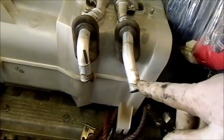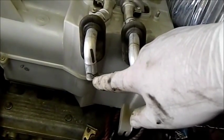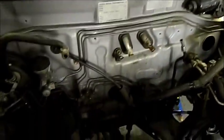So very, very worthwhile activity when you service your car to change your coolant every 40,000 Ks. That's what Toyota recommended. It's a lovely red coolant. It comes in a small bottle, a small concentrate, and you just mix it with regular water, and it really does do the world for your cooling system.